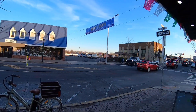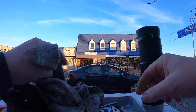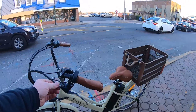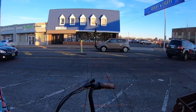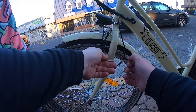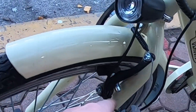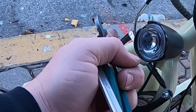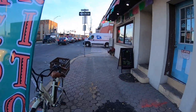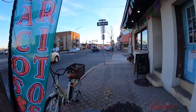We're back on my bike, it's a whole new day. But first — this is the lady downstairs' taco delivery bike, and I noticed the brakes are pretty bad on the front. They're not adjusted right. See how this one moves a lot but this one barely comes off? You gotta adjust the spring. It's really easy — these little Phillips screws, you pull them out.